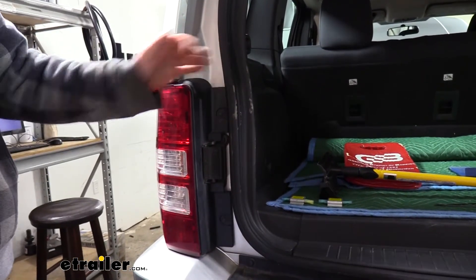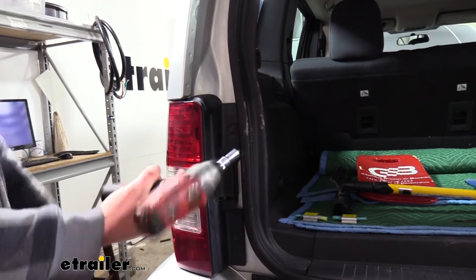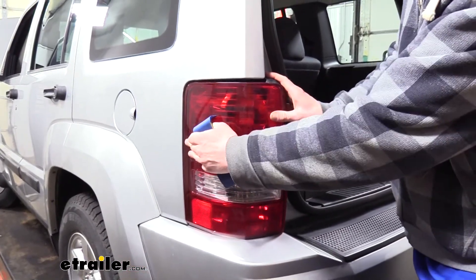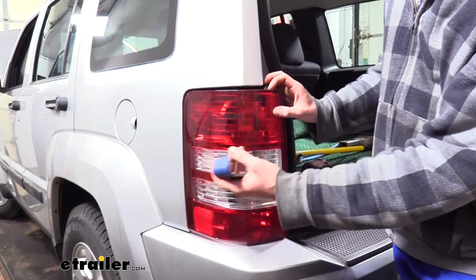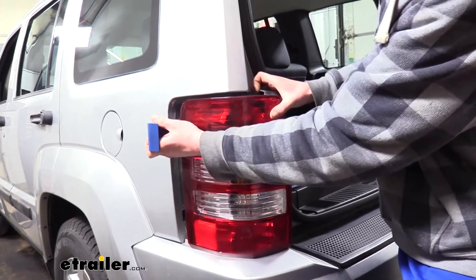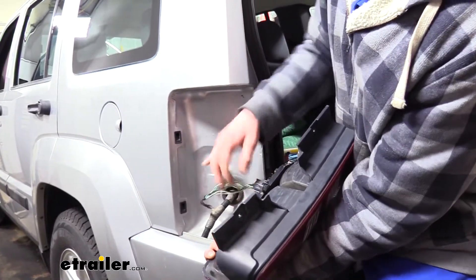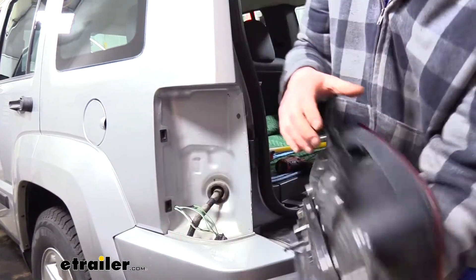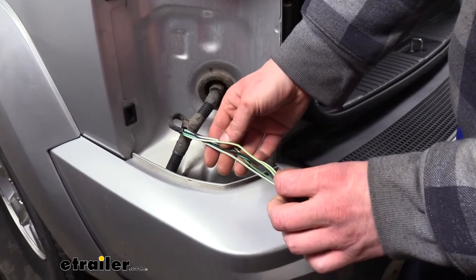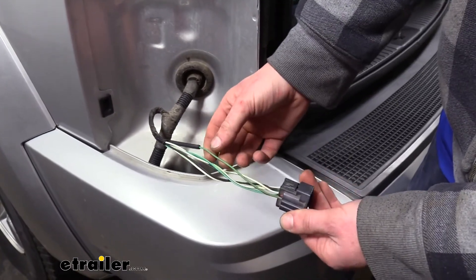We're now at the back of the vehicle with the lift gate open to remove both driver and passenger side taillight assemblies. There are two bolts holding each taillight assembly in — remove those with a 10 millimeter socket. Pull the assembly rearward; if it's stuck, a plastic trim panel tool will help prevent damage. On the backside, disconnect the electrical connector by pressing the release tab. We'll then peel back the sheathing on the wiring to expose it — you can peel it off or use a razor blade.